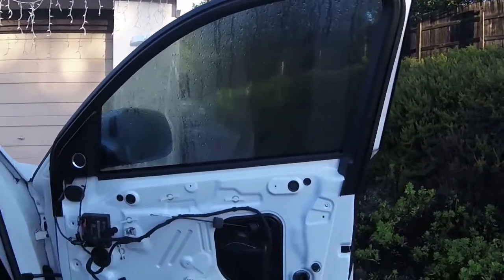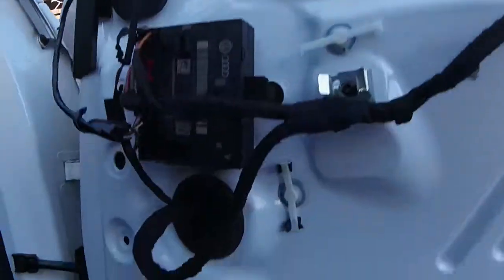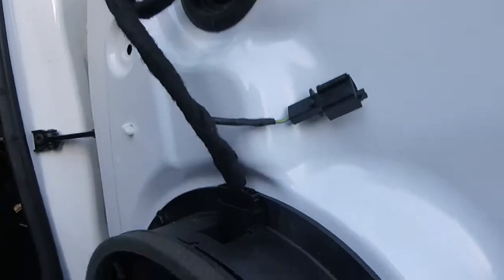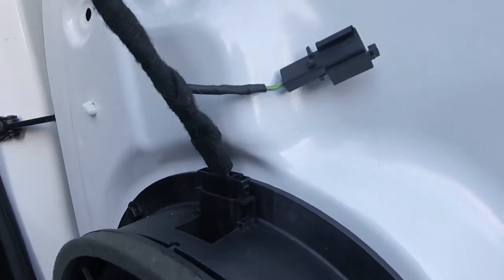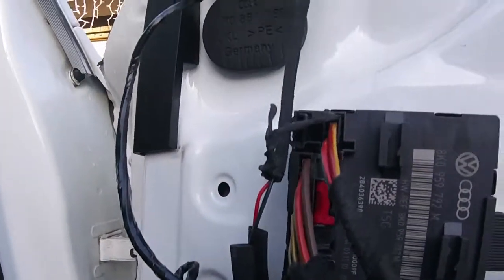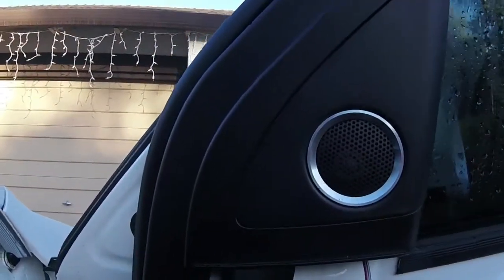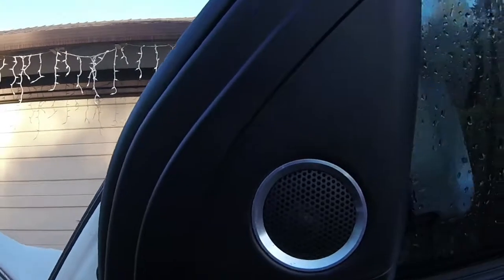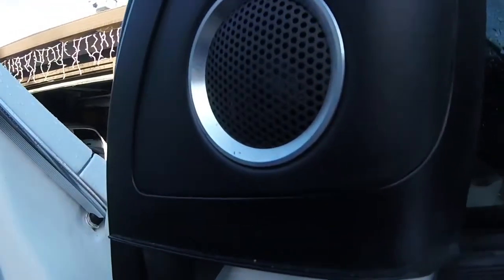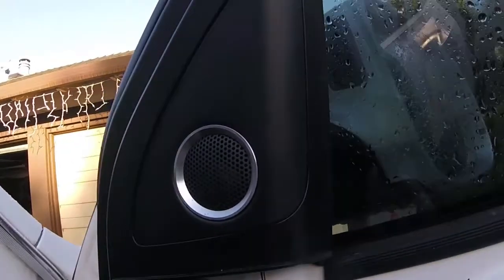If you saw my last video, this would look pretty familiar. Passenger side is still apart. All I had to do was tap into this plug here for the main speaker and add an extra bit of wiring that went up to the tweeter. The tweeter grille just doesn't look that great — you can see that there's raw machining marks, which is not how the factory B&O is. The fitment leaves a bit to be desired. This side is actually better than the driver's side, but I did have to trim to get it to work.